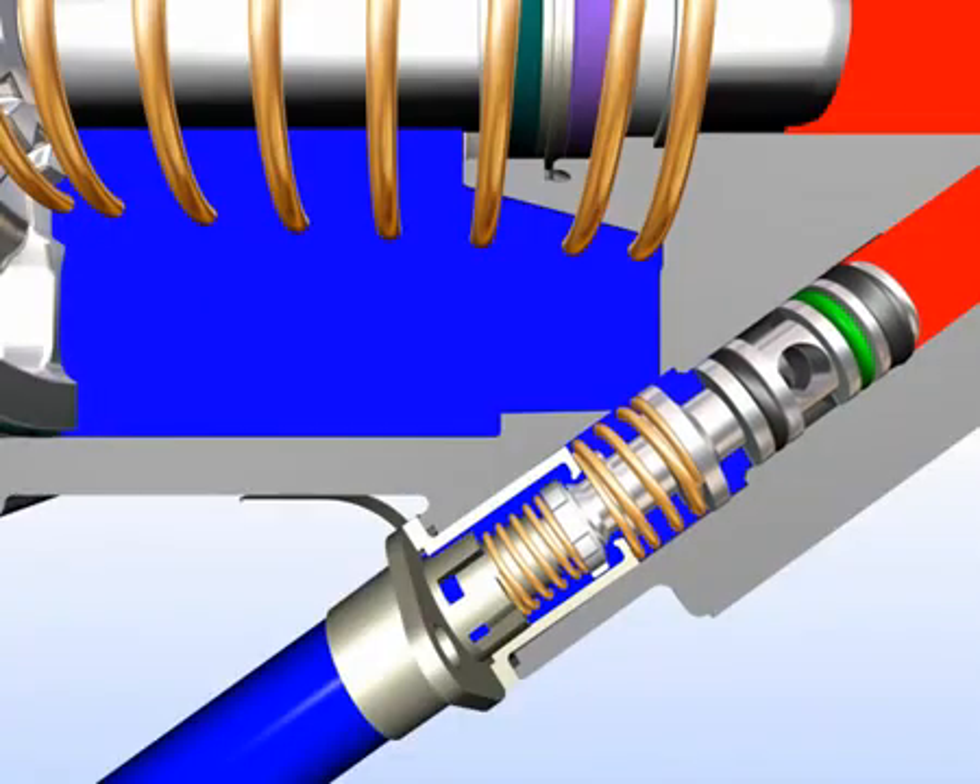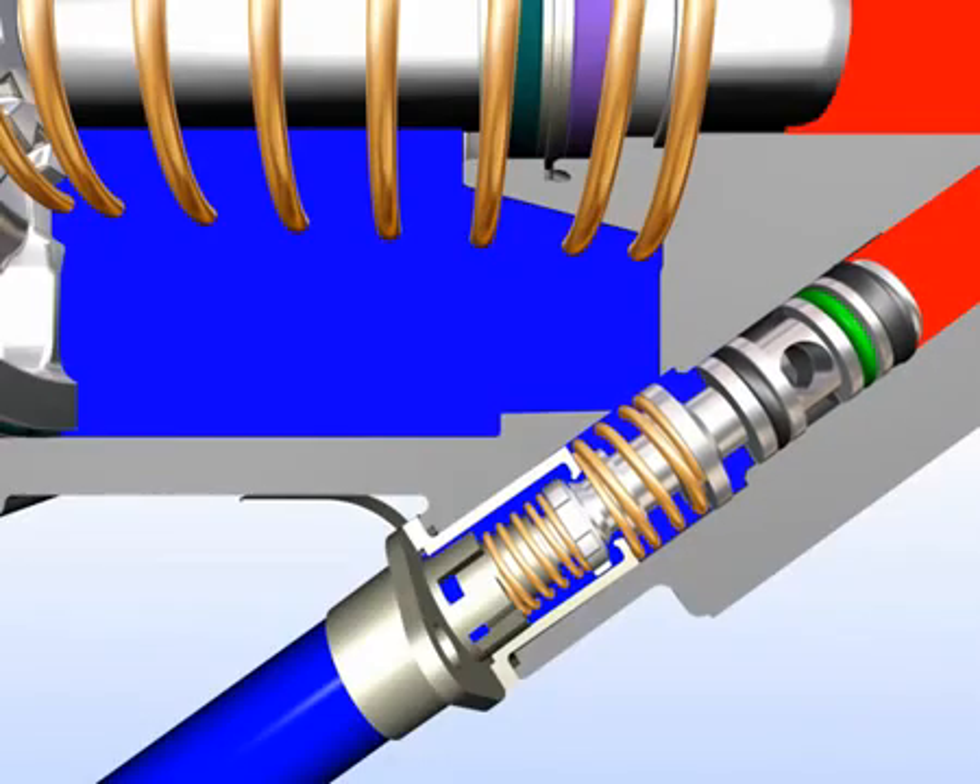The compressed air will be regulated into the air chamber by the aperture between the spool and the air valve. A dynamic balance will be established between air pressure and hydraulic pressure that will be sufficient to operate the clutch.